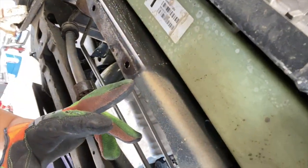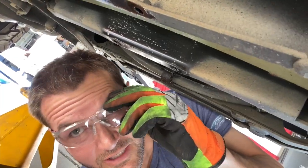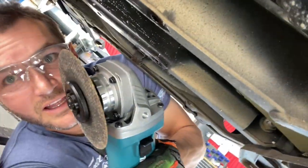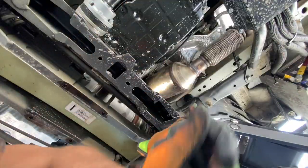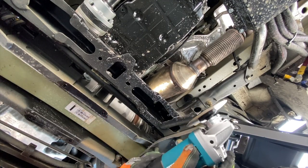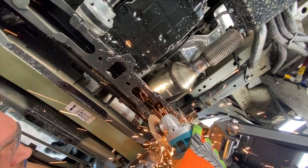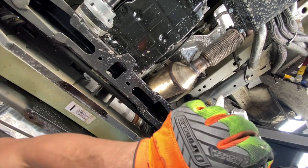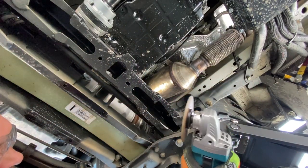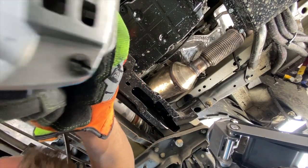We have removed the leaf spring skid plate, and coming in from the front of the vehicle, this area towards the back needs to be cut out along here and here, and the same for the other side. That means we need safety goggles — aka the rec specs — gloves, and a cutoff disc. So I will cut these out and we will proceed. We cut the hole down — fire, that's fun, still smoking. There's a hole in the glove. Hot hot hot — I'm fine, it's just hot, just getting covered in molten lava.